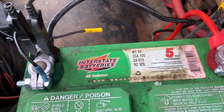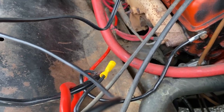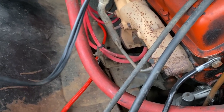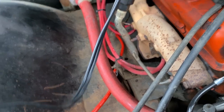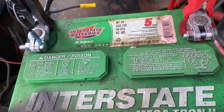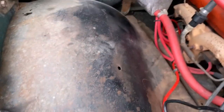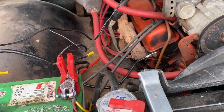I've already done some work hoping it was another issue. I've got brand new positive and negative two-gauge battery cables on here — the old ones were questionable and starting to show corrosion on the strands. The battery isn't in the greatest shape but is still serviceable, and this isn't working even with a large jumper on it — the kind I use for starting big diesel motors without any issue. It's just a matter of the starter having issues. Let's go look at the solutions we're going to employ.